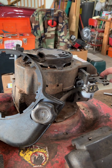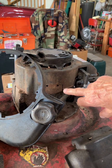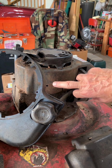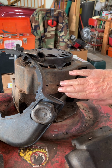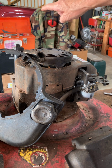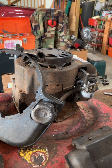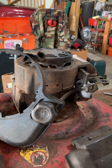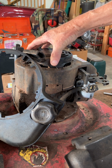It's always tricky right up there. Oh, that's too much there. Okay, so now I've got this under the rewinder, this side under the rewinder, this big piece is out. This keeps this in position so that when the flywheel's turning, this isn't going to go in and be attracted to the magnet and going clunk, clunk, clunk, because that has happened to me in the past where I didn't have this in the correct position. I had to go back in. Oh, yeah, there it is. So that's looking good.